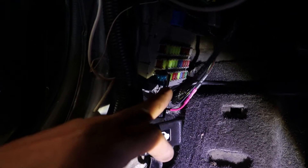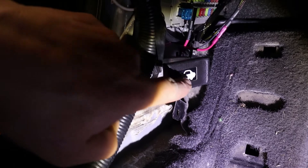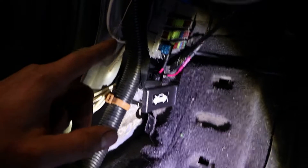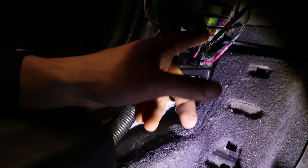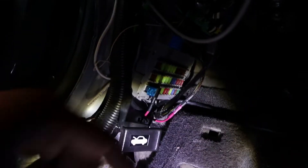Here's the fuse location — I went with number 2, that's ignition coil. The ground, I just went to one of these bolts on the hood latch — anything that's going to ground out, and that was the closest one. I've got multiple wires, some going up to the gauge and stuff. I'm going to make this look a little bit cleaner. That's grounded out, and that's going to number 2, which is ignition coil — not the fuel pump. And then the yellow wire is going through that grommet now, out the top, kind of looped around right here.